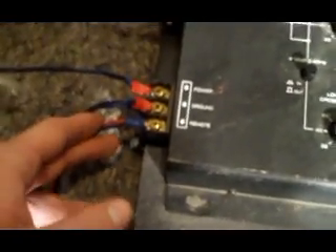Then all you do is splice the power, ground, and remote wires. This one actually has all blue wires running because the color doesn't matter much — it's less confusing when you know what's going on, and I just had a bunch of blue wire. Right here's your power connection. I have one of these little fancy connectors running into it so it just goes right underneath the screw, but really all you gotta do is cut your wire with your crimpers and stick the power wire underneath this screw here and screw it back down — works just fine.